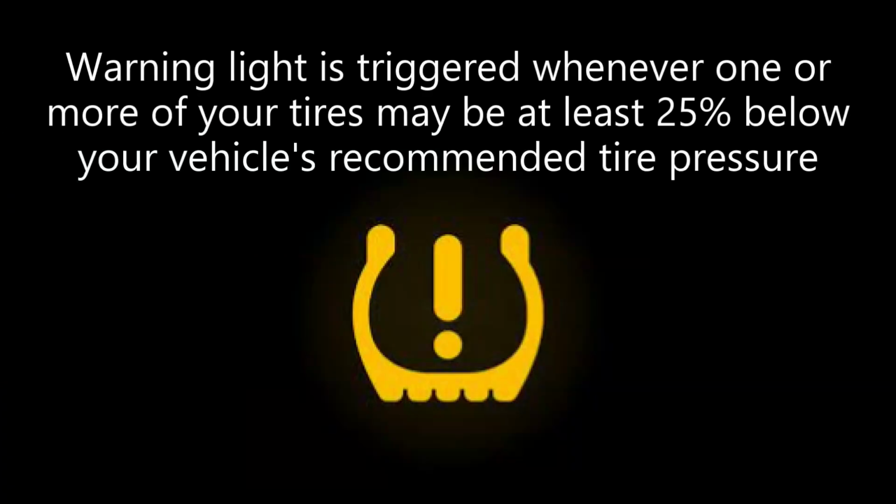A properly working TPMS system will also give you an alert on your dash when any one of your tires has an exceptionally low pressure reading. And if that happens, you need to get that tire aired up as soon as possible, and then check it for damage to see if there's a specific reason why it lost that air.